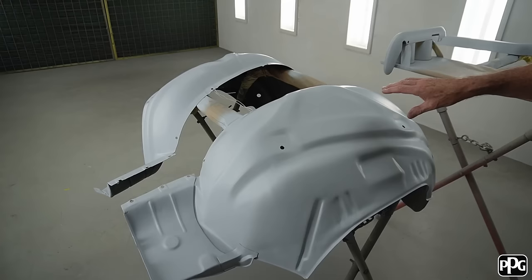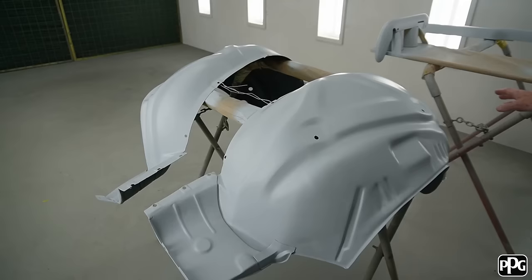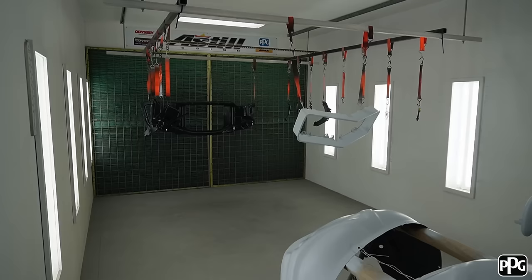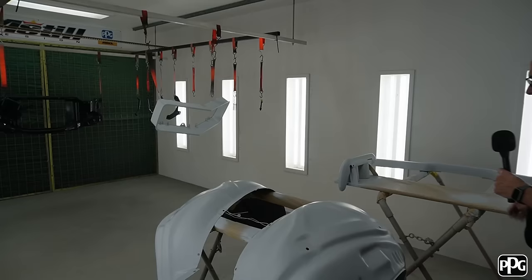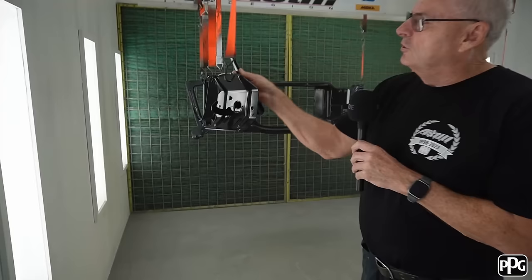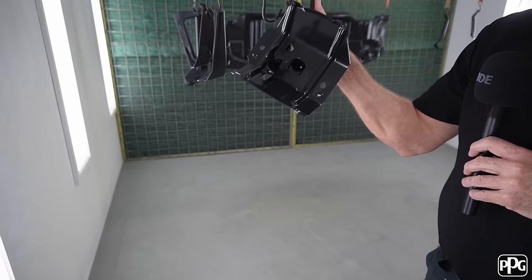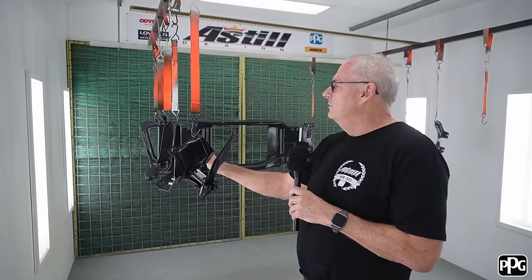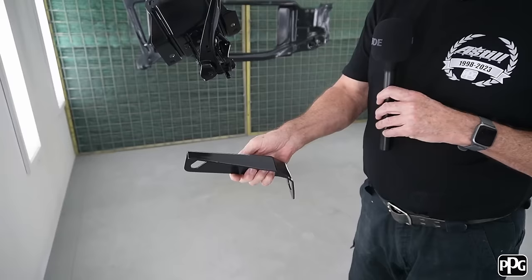On the weekend — these inner guards have been epoxied, then we used the spray poly, and now they're back into a high build primer. I'll get those all rubbed out, same with the bumpers and the nose cone in the high build. All the other parts down the back are in the 4949 Delfleet. I wanted to do those to make sure anything showing up as an issue gets caught early. So far so good — the primer lays down nice and flat. By the data sheet I can leave it for up to 14 days and still apply paint over it without rubbing, but I plan to give them a light scuff anyway.